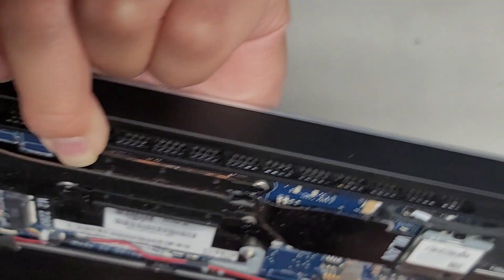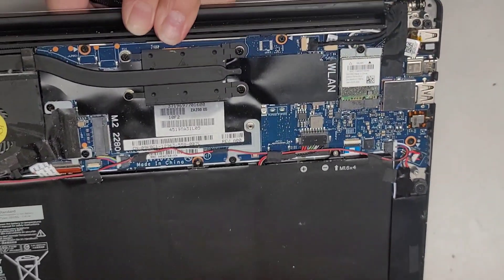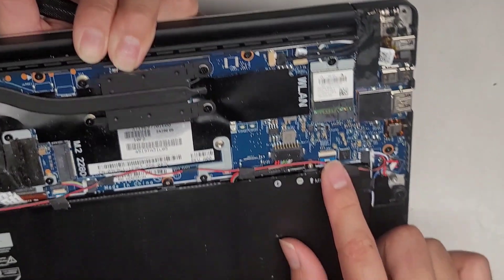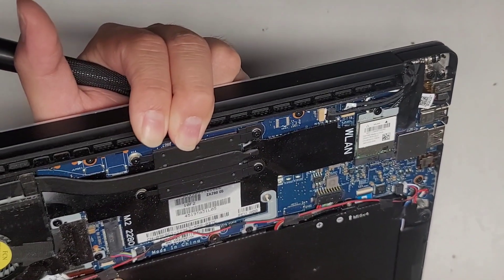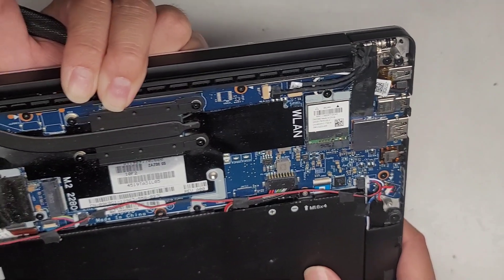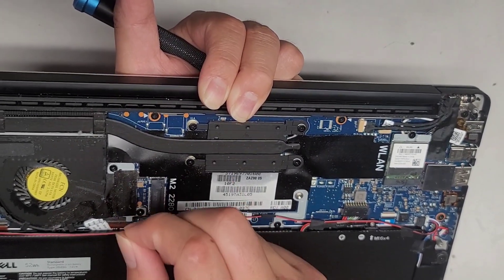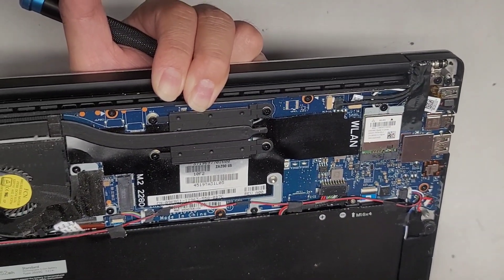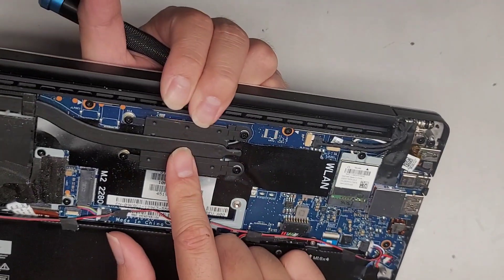Why does this have so many cables going up into the screen? I'm not sure if it's a touchscreen or what. There's a small cable here and another cable — this one says JKB1, so I'm guessing that's for the keyboard, and the other one says touchpad. So touchpad and keyboard — that's pretty much all there is. The LCD LVDS connector has two screws and pulls straight up. Before you do that, make sure to disconnect the battery, open the laptop, and press and hold the power button for at least 15 seconds to drain residual power and prevent shorting anything on the motherboard. The CPU is soldered to the motherboard.